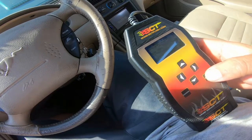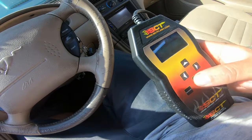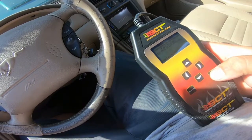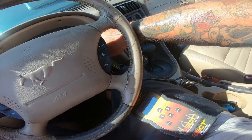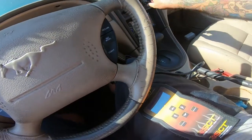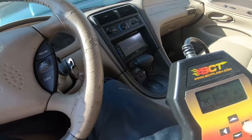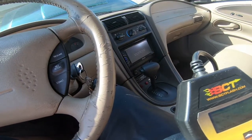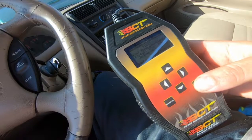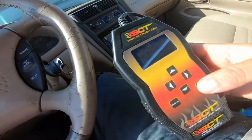So we got our 1460 and 1237. We got that wide open throttle one. So let's see this other one, secondary circuit. So those are the two that we've been having. Let's clear them. All right. They are cleared. Fuel pump secondary circuit, fuel pump driver module. I've already replaced that though. That's what I just replaced.